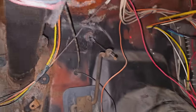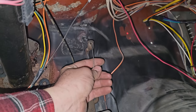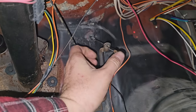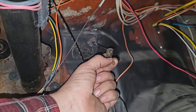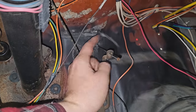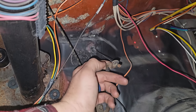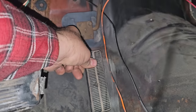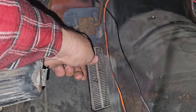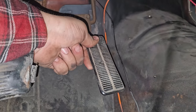So guys, moving on to the throttle cable. This is your typical old school GM style. And it is not going to work because it's too short on the other side. So I'm going to snip this here. Just pinch this. We'll push it right through the firewall. And then I got a super cheesy little Mr. Gasket thing that should hopefully work, as long as it's doing this correctly. Mostly this. Not so much this. Then we're good.